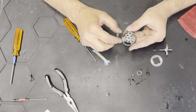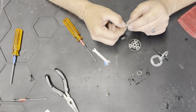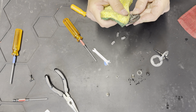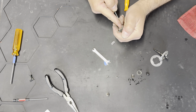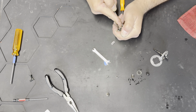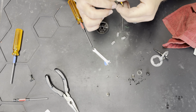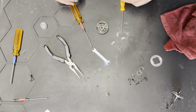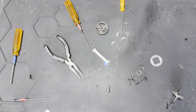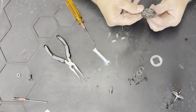This one doesn't look like it's going to fit in reverse — I had one car that fit both ways, it may have been the Bandit. I'm going to get this cleaned up and then we're going to reassemble. Go ahead and pop this bearing out right here. That bearing is actually worn out — let me see if I have one. It's a 5116 — it took some searching but I actually had one. I'm going to fit that in there. The bearing had a little play in it with the Hot Racing spur but it fits just fine.